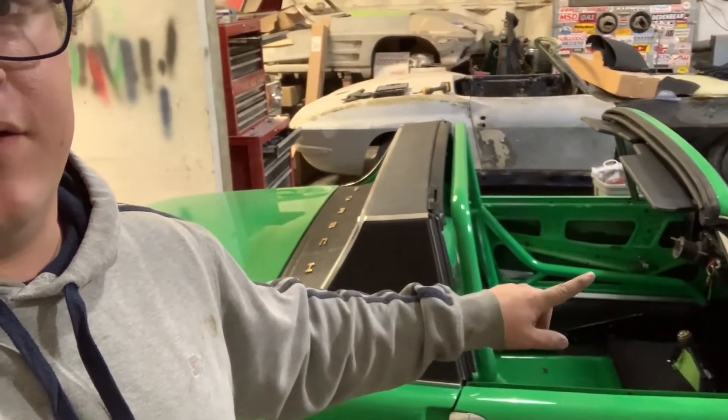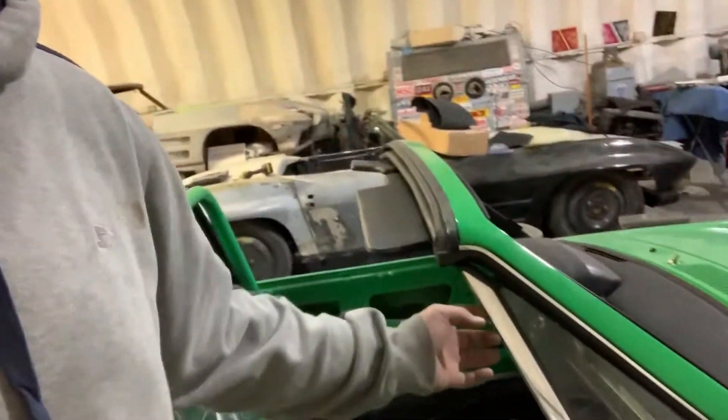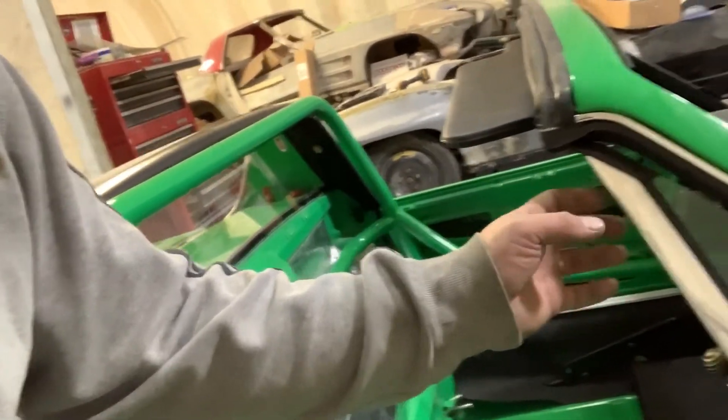There are still a few pieces left — we have door panels. We are still waiting on parts for the windows for this car. It's a really weird thing. We were thinking this was a '73, but it turns out it's a '70 or '71. In that three year span, there are several different window configurations. This particular one being an earlier model has a channel inside of the window frame that has little rollers that go up and down with the window. The later models do not have that. So we had to order some new little rollers. Some people have asked why not just change the regulators — well, the actual regulators themselves are different too. So it's a whole long list of things that don't fit, and we've had to wait on that.